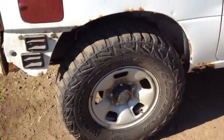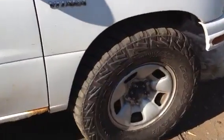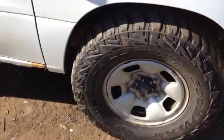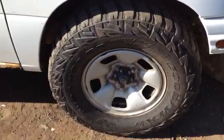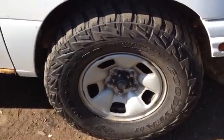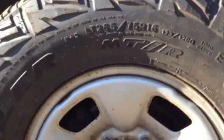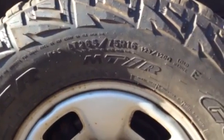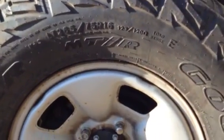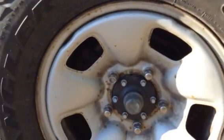I lifted the vehicle up without buying a lift kit or using spacers, and put big tires on it. They were rubbing in certain spots. The tires are 265/75/16, E-rated mud and snow, load range E — a 10-ply tire that can take 80 psi.